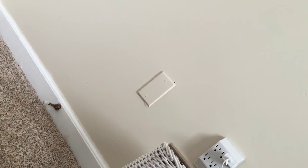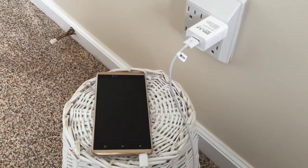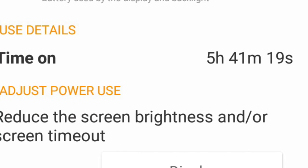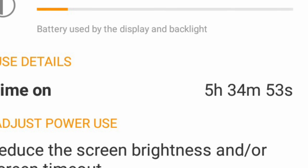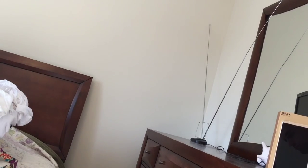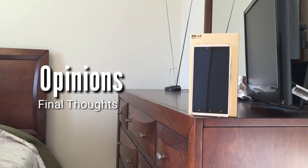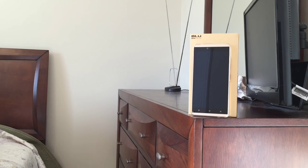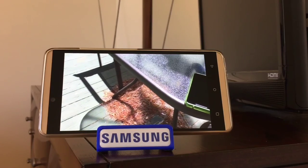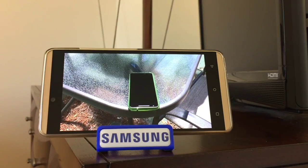While testing the Vivo XL, I was able to consistently get about 5.5 hours of screen-on time out of each charge cycle, which I found quite impressive. Towards the end of my review period, I really tried to stretch the battery life. With moderate usage, turning off various connections and using airplane mode, I was able to get over 7 hours of screen-on time over about 3.5 days. While the Vivo XL's display is only a 720p panel, I was actually quite pleased with the screen quality — I enjoyed the saturated, punchy colors that AMOLED displays are known for.